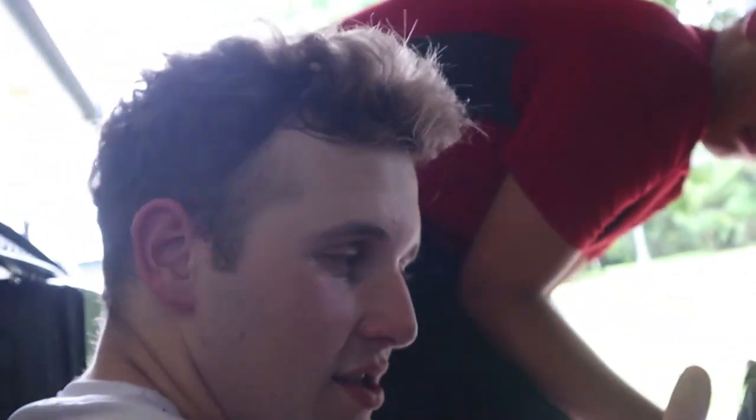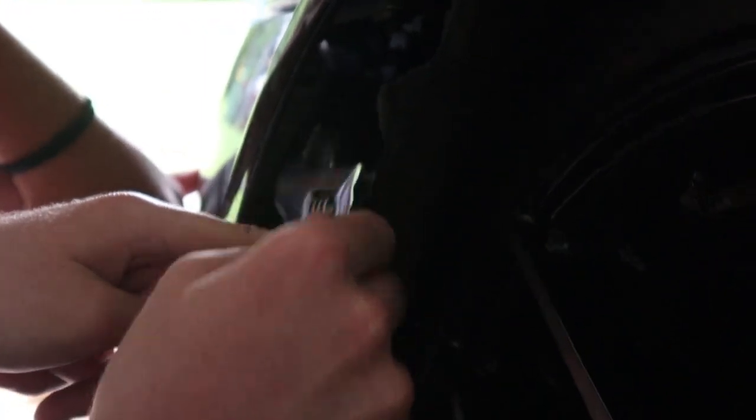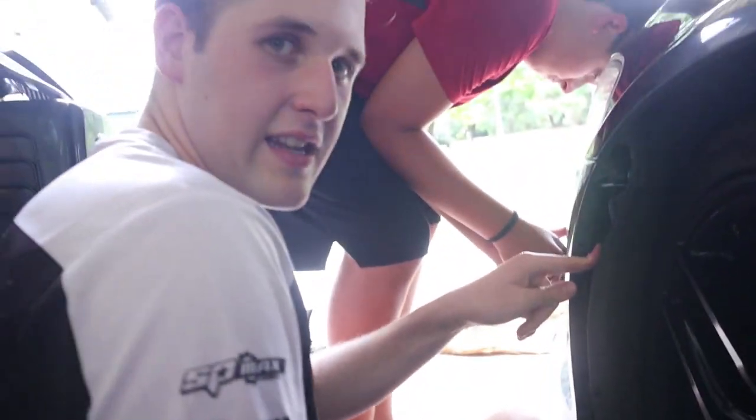So for us to get the front bumper off, you'll see that there's two screws, as Alex is pointing at them. Yeah, one on each side. We just need to get that front one out. So you need to pull this little plastic flap. Actually, there's one a lot further in. Yeah, there is. So there's two there. This little plastic flap, and then we can't get a ratchet in, so we're just using a shifter and doing it that way. So you just do the two of them, and then all you got left is clips.